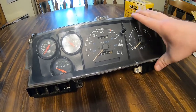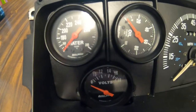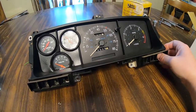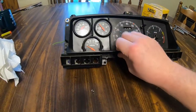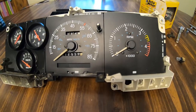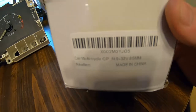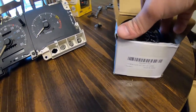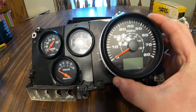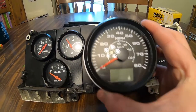If you take out the screws around the perimeter, the clear plastic cover comes off and then the black trim piece that goes around all the gauges will come off as well. It's got four individual panels that just snap into the white main piece. Here's the budget GPS speedometer I'm planning on using — an Amazon special, about $34-$35, and it pretty closely matches the Autometer gauges I've already got. It certainly beats paying $350-$400 for a gauge for a truck that just doesn't need it.